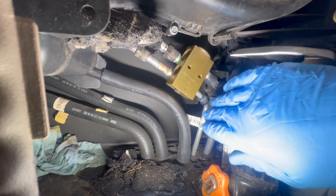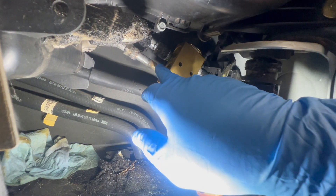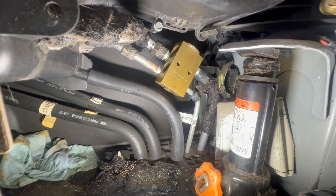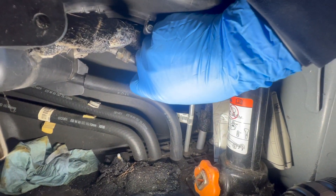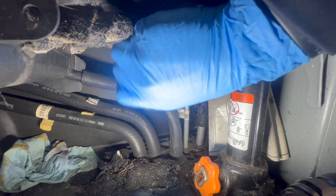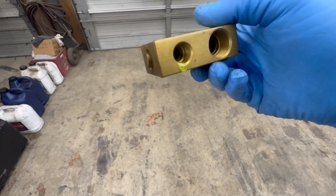You can get all your fittings loose like that so you're not twisting anything around. We've got our lines loose and you are going to have to take these two lines towards the back of the truck and tweak them back just a little bit, because you can see these lines fit down in the block a good bit with O-rings on them. Be careful — don't bend the lines too much, but just tweak them enough to get the valve loose.